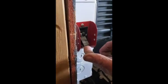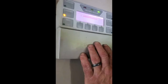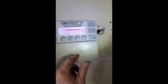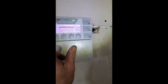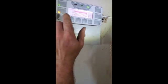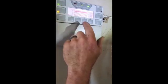First things first, we're gonna turn the main power back on to the panel. And then we're gonna come over to here. You can hear the generator just engage. We're at 52, 51.6. It just illuminated, so it's charging the batteries back on because we have the inverter lit up right now.